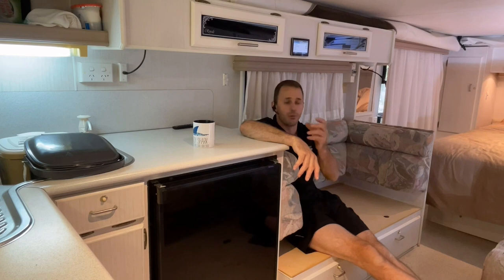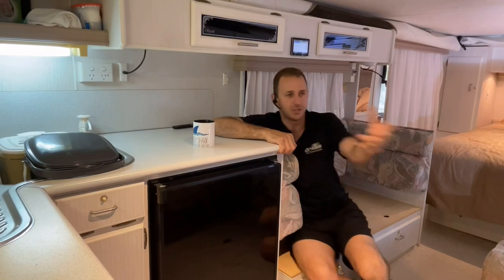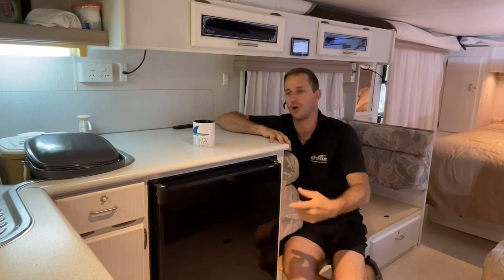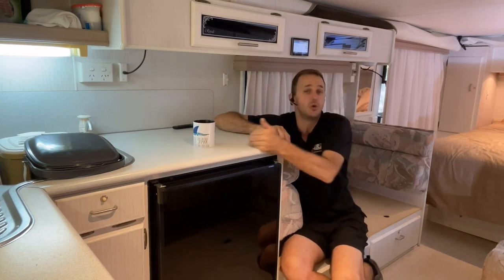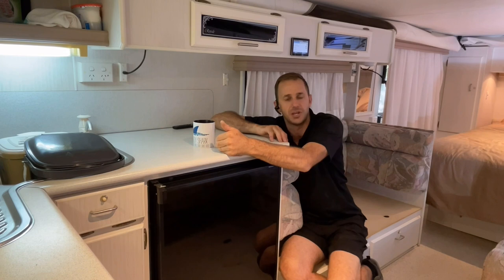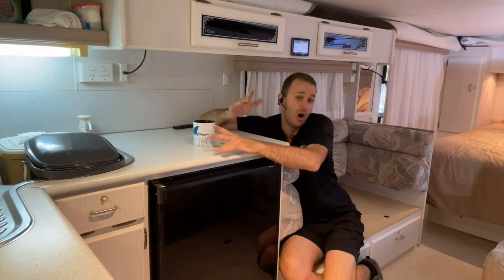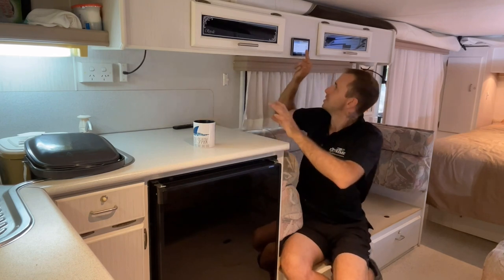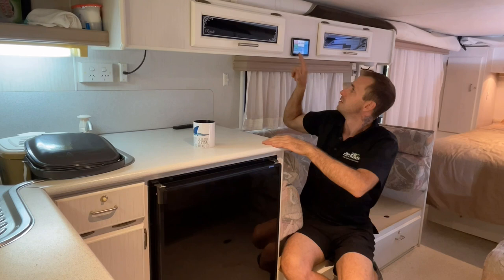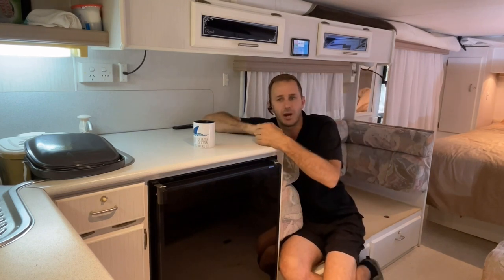And he's got a brand new Honda 2.2 generator. So because he's got it available, I told old mate to get it out and plug it in so I can actually show him how to set this up so you can pull whatever you want out of the generator. So, with a 2.2, I'd probably set that at say 9 amps or even 8 amps as an example, which is about 1850 or 1800 watts or so. So what that means is when I set this current limit here to 8 amps, it's only going to pull 8 amps from the generator at a maximum.